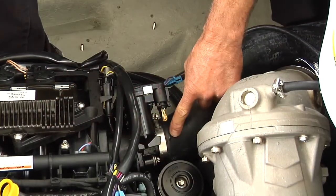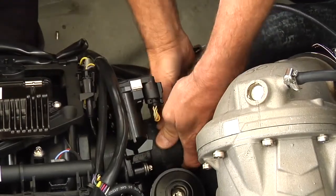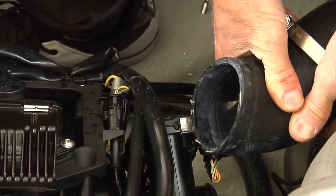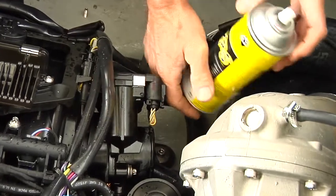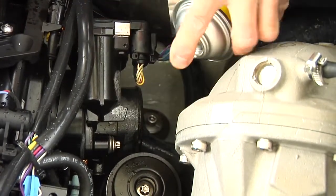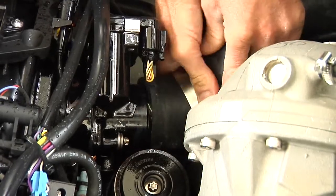It is important to remove any trapped water that may have accumulated from condensation in the intercooler. Remove the intake hose from the throttle body. Start the engine and increase the throttle to rev engine speed to 4000 RPM several times. Stop the engine. Dry any moisture from the throttle body. Liberally spray XPS lube to lubricate the throttle body inside and out. Remove any excess XPS lube from the throttle body intake hose flange, then reinstall the hose.